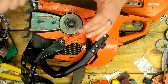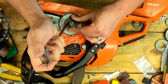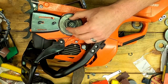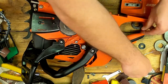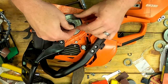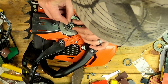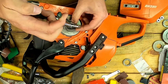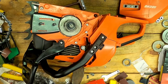All cleaned up. With the rim sprocket system it's very easy — just pop off your c-clip, and be careful because it will go flying across the room and you will not find it. I've probably got about 20 clips hidden in the corner of the shop. The retainer comes off, rim sprocket comes off. We'll replace it with a steel 8-pin sprocket. Everything goes back together in reverse. My trick to getting the c-clip on: get it started, then use a pair of pliers to squeeze it back in place. That's it.